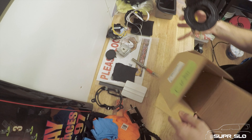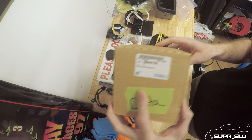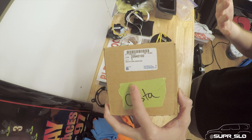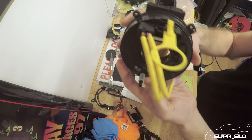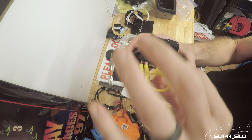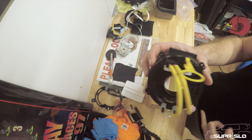It is now Tuesday and our part has arrived - the new clock spring. If you are replacing your steering wheel in your HHR, here is the part number. You can get it from any GM or Chevy dealership and it will usually arrive in 24 hours. The cool thing about this clock spring is that it is just four screws - two on the bottom, two on the top. Notice there's a lock here that keeps it from moving out of position. You have to get this centered up, make sure it's set in the right place, pull that tab, and then you can put your steering wheel on.